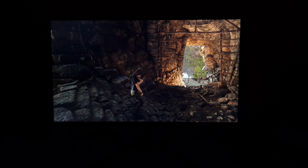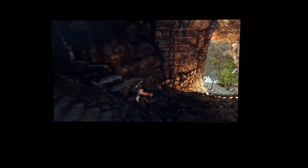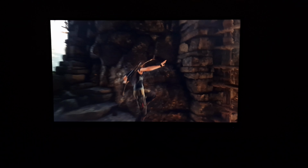If you only use a set of settings for SDR and you're happy with that, then that's okay, because it will remember the settings that you selected before selecting HDR on. This is for SDR, remember. When you're actually running HDR, so that means you've got an HDR signal, then the monitor switches to its HDR mode if you've got HDR set to on, and will just do its thing. There's really very little you can configure. So I'm not sure if you can see exactly what was greyed out there, but basically everything, you can't adjust the brightness, the usual restrictions apply really, you can't really adjust anything, so it's just one experience that you get for HDR.